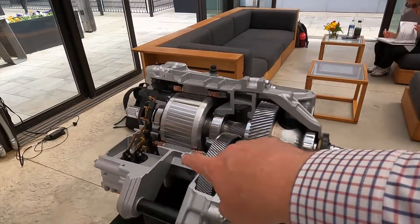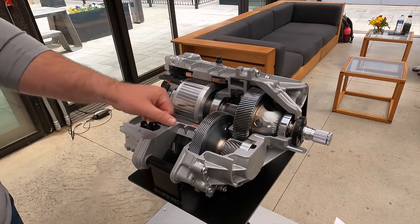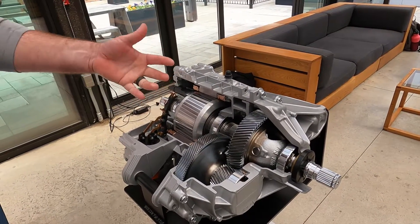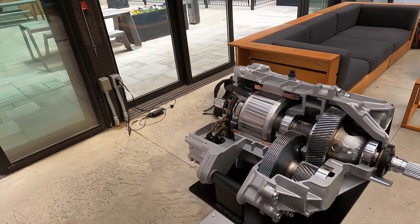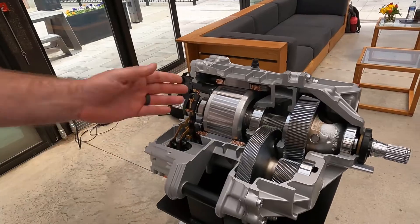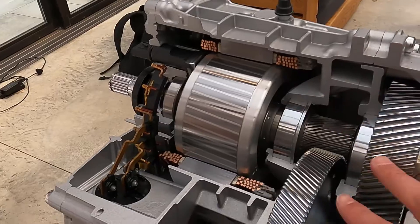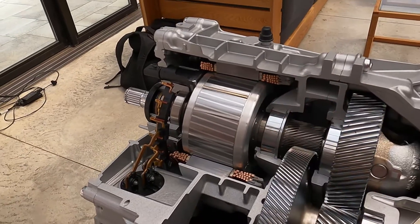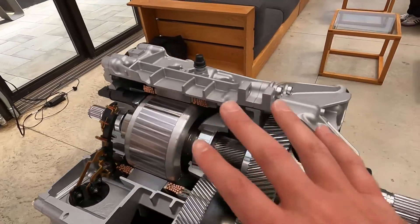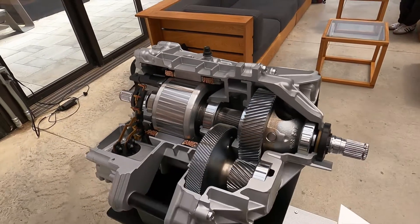What's this bit right here? This is the connection ring on the stator — it was cut away for visual purposes here. There's actually one wire that's still connected in here. But that's how it connects the leads to the stator. So that's literally what gives it electricity to do its job. Yeah, it looks different with the cutaway so you can see the rotor. Doug, thank you so much. This is great to see a cutaway and get a sense of how you can basically just throw in a motor and transmission with a differential without all that much space and have a rear drive unit like that. That's super cool.